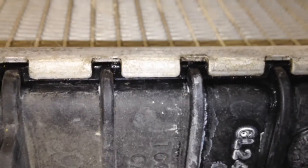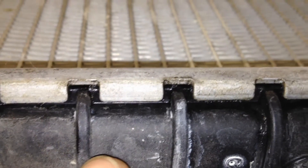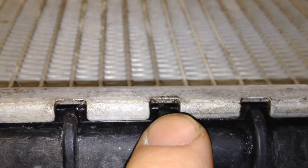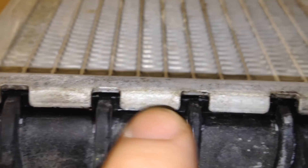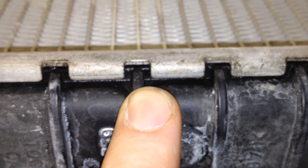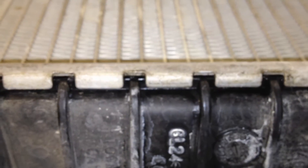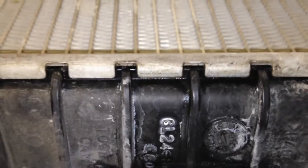Up top, if you look at the top of your radiator and everything looks fine and dry, you can't see anything obvious — you have to look in between these crimps. You can see how it's wet in there, and that may be the only indication it's leaking. Pay close attention to these because they usually leak under high pressure — these run at 20 psi, whereas older radiators ran at around 16 psi.